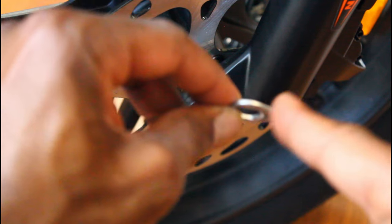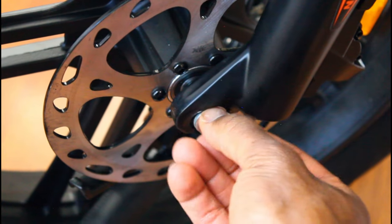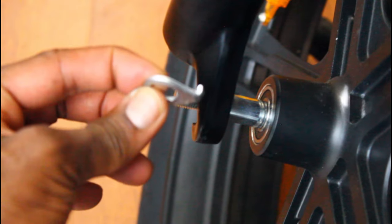I'm going to put the washer with the lock on it first, then the other washer. The bike wheel axle seems a bit too narrow to use both washers, so we're just going to use the washer with the lock on the other side. On the left side of the bike where the disc brake is, I took the extra washer and put it on the other side of the front fork.